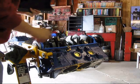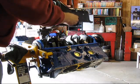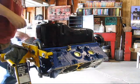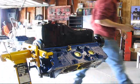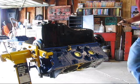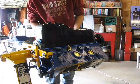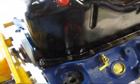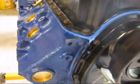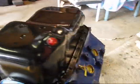Okay, so I've got the oil pan. Got the gasket on and my silicone in the corners. Set this pan on here. Again, I'm oiling the bolts. Okay, oil pan is on and torqued down. You can see the silicone moves out of the corners there. Here. And there. That must mean it's a good seal.